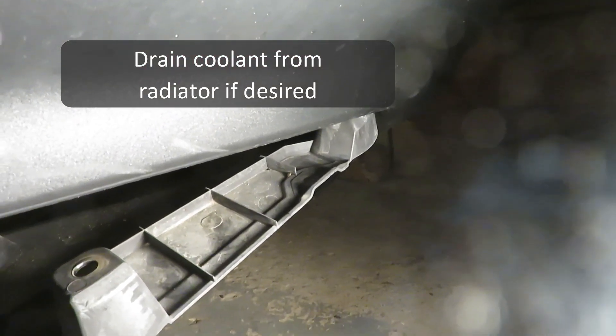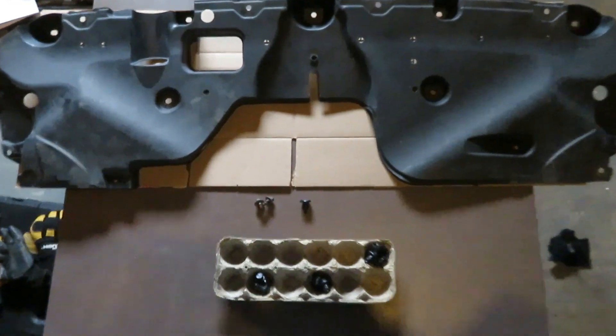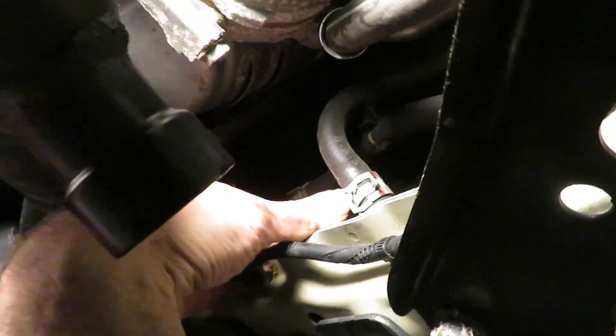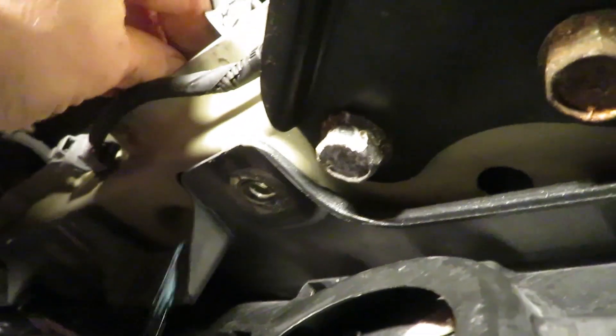I want to change the coolant — it hasn't been done on this vehicle. You don't have to, but you're going to lose a lot of it when you change the pump anyway. The petcock is right here, and unfortunately on this particular model you have to take the bottom panel off to even get at it — it's bristling with panel fasteners and bolts. Coming in from the passenger side, there's that white plastic lever. Got a wrench on it, broke it loose — it wasn't hard. Now we should have coolant coming through here. I've got a pan under here to catch it. There it comes.